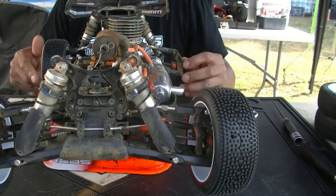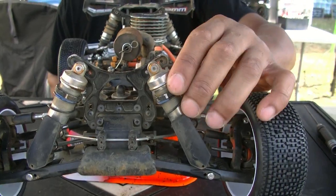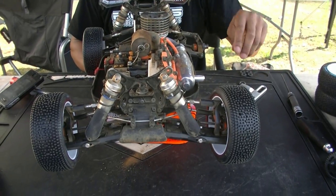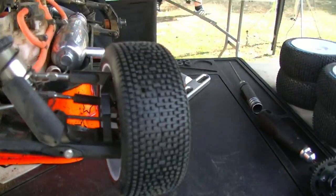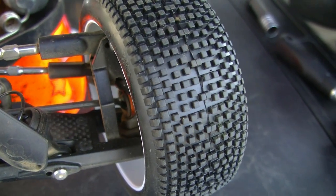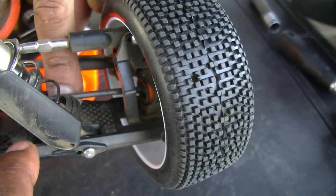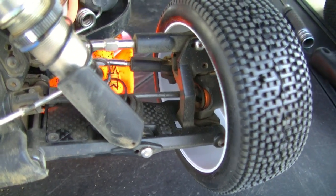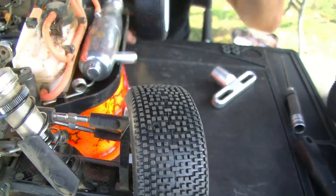And it's just so... That suspension, is that active coils? Yeah, and oil filled. And different pistons, once again, change the pistons, bigger holes, smaller holes, change the rebound. It's so much involved. You've got different carbon, spring rates as well. Yeah, different spring rates, and that looks like there's a little insert of carbon. Yeah, carbon there to stiffen up the arms. On this car, not on all, you either fit plastic or carbon in the centre of the arms to give you a limited amount of flex, or the plastic ones give you more flex.